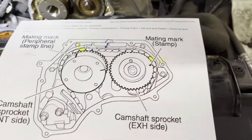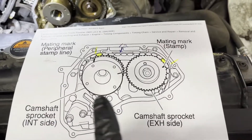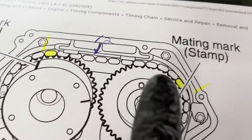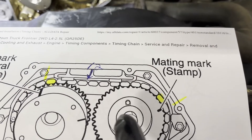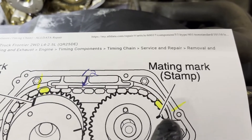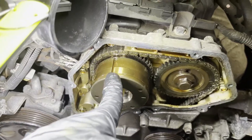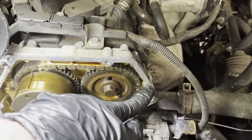The last thing I want to go over with you guys — if you look on Alldata or Mitchell or a place like that, get yourself a diagram of how the timing marks work, and you'll see what I'm saying. This hash mark here is slightly forward of this interior bolt, and it also shows the keyway for this sprocket — your exhaust gear has to be slightly to the left, it can't be at 12 o'clock. The secondary hash mark here is above the cover bolt hole, the thread patch. So everything I explained here is right here — I showed you how these marks work with the reference of the bolts and not being perfectly at 12 o'clock, and then the hash mark here with this bolt hole.